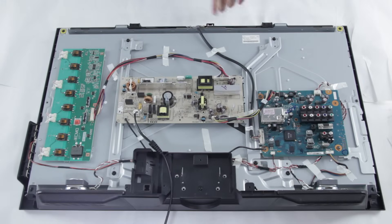Something that's a little bit unique about this TV is that the T-Con board is actually bonded into the panel, so you would not be able to replace this T-Con board. We're going to take a look at a different TV where you would be able to replace the T-Con, where it is located out here on the panel similar to these other parts in this TV.